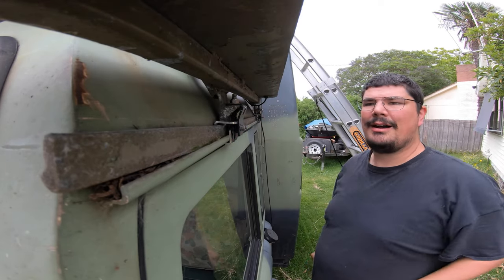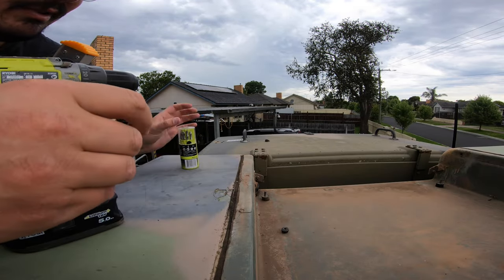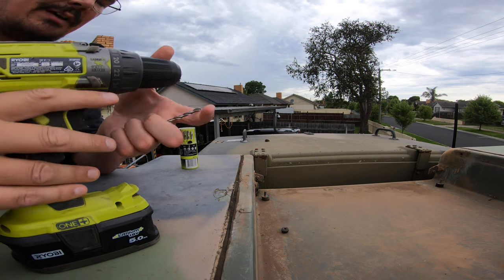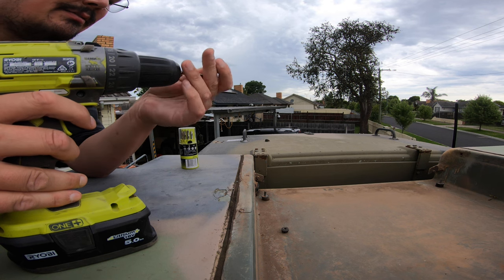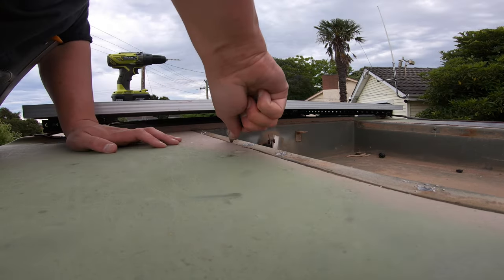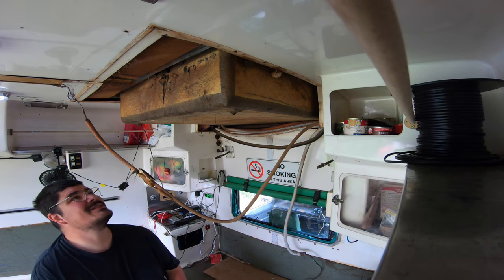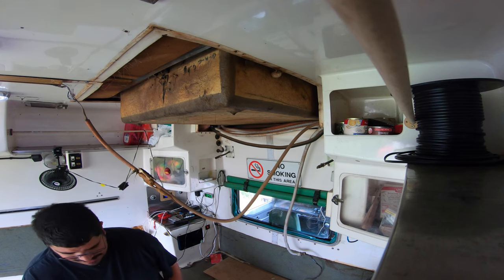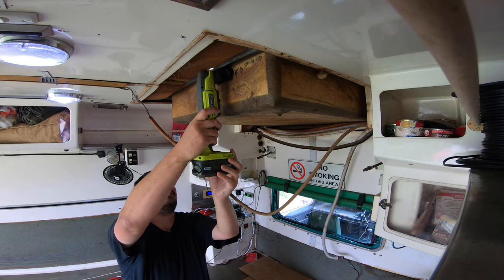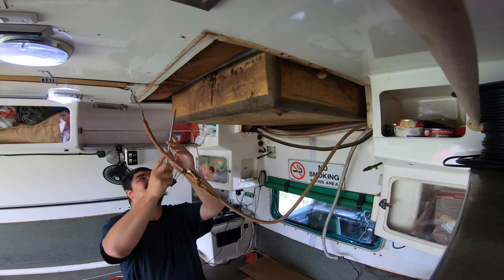There comes the tedious bit — I'm going to do this half an inch at a time on both sides. I figure it's going to start by drilling some rivets up the top here. That roof box without two people is going to be a bit of a pain to get too far forward, so I'll drill the rivets and we'll see what we can do from the top. I'm going to try and hit this, see if I can bust some rivets out. I could theoretically clip them off from underneath. I found a nifty trick — I can soften them up with this and they just pop off some of the time; the others are so far gone they prise off with a screwdriver.